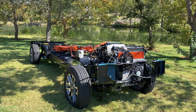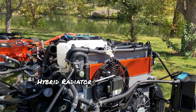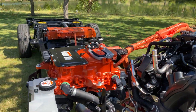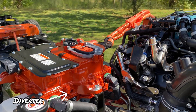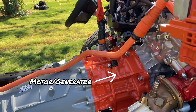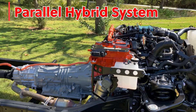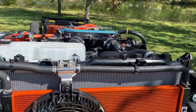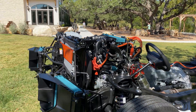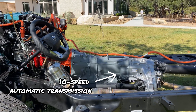Let's take a look at this system. For color coding purposes, it's required that hybrid parts are orange. This is the hybrid radiator — it works directly with the inverter, and then that comes down to the motor generator. This right here is what's called a parallel hybrid system. Here's the gasoline engine, and the motor generator is right between the engine and the transmission.